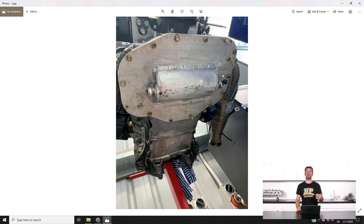And then of course when you're at high RPM and maybe jump on the clutch - real typical with a drag car at the end of a drag pass - the driver will jump on the clutch. Initially the engine is still at very high RPM, maybe 8,000 to 10,000 RPM. But as soon as the driver gets off the throttle and the engine's slowing down, there's much less blow-by but the dry sump pump is still being spun over. So there are some considerations we do need to take into account.